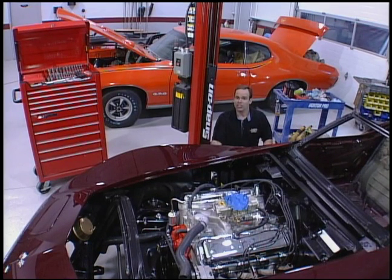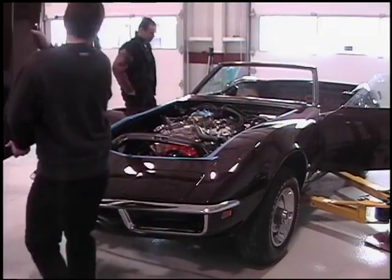You can also do the same shimming the front mount. It will actually bring the whole front of the car slightly up, which brings the back of the door slightly down. So you work between those two points and get the back of the door nice and even. That's how you set the gaps on a frame-off Corvette like this.